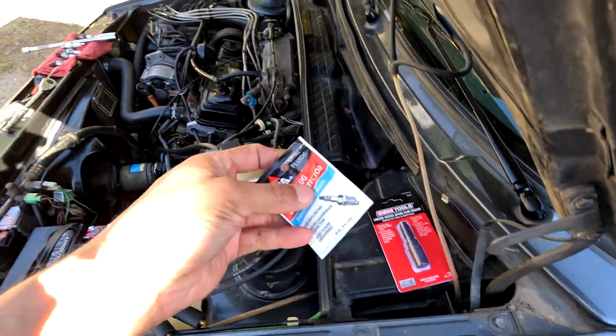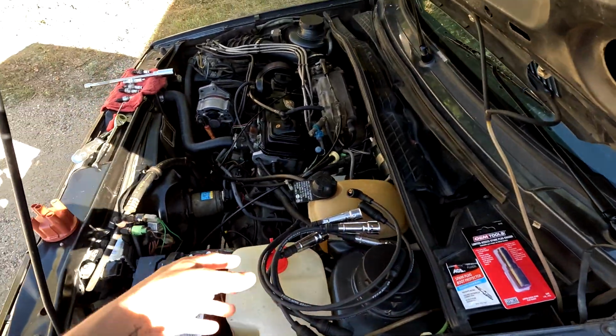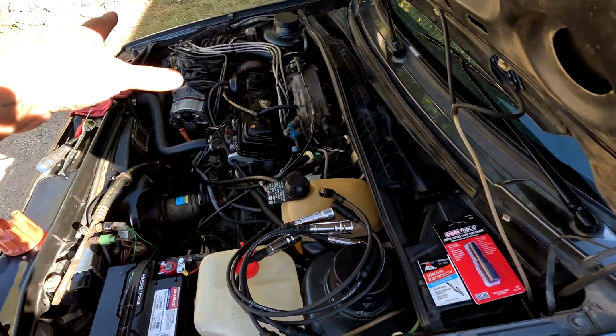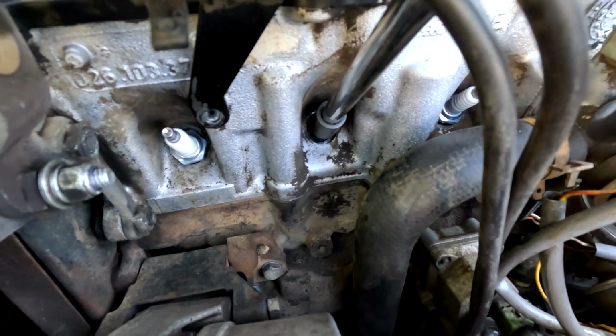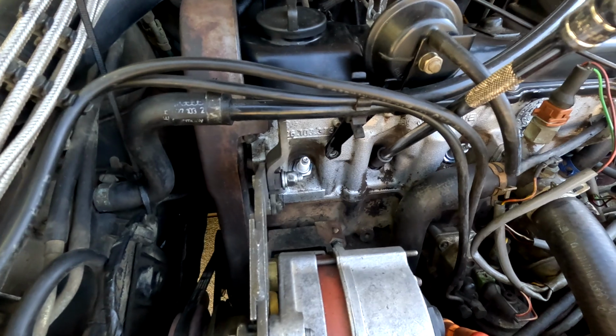Also have some grease here to go around the edge of this, keeping the metal shavings stuck to it, and hopefully not falling too much down into the cylinder. That's the plan. Hopefully this goes well, and we have a nice fitting spark plug after this. All right, there she is. Sent it down as straight as I possibly could. Went down without too much trouble.